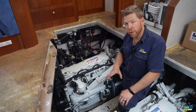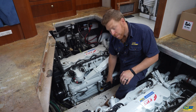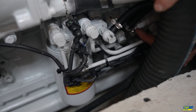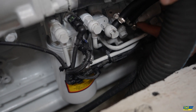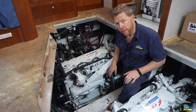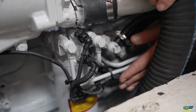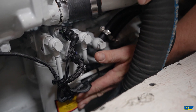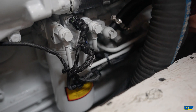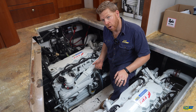From the primary fuel filter, the fuel lines come in and are tucked down here. The supply fuel line comes into the low pressure fuel pump, which is connected directly onto the high pressure fuel pump, driven by a gear in the timing case of this engine. That low pressure fuel pump pulls fuel all the way through from the tank up to this point. It then travels through a secondary fuel filter here, which is a higher micron filter to clear out any further particles in the fuel before it travels into the high pressure fuel pump.